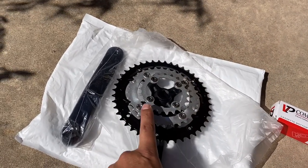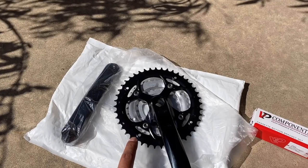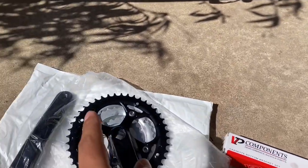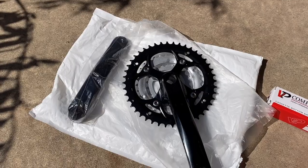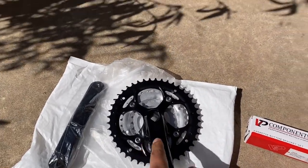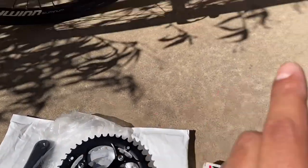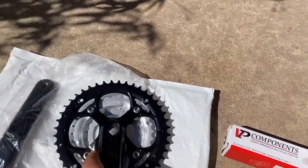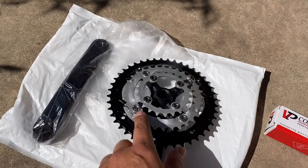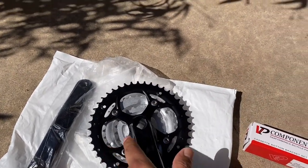What I'm going to do is take off the two smaller sprockets anyway and leave it with the single. The only difference is I'm going from what I believe is a 48-tooth sprocket down to a 44-tooth, so it's slightly smaller. Like I said, one of the other mods I did was take it from a three-sprocket crankset to a single, and I'm going to do the same here. Unlike before where I had to drill out rivets, these are actually screws, so I can just go ahead and take them off — and who knows, I could probably upgrade in the future.